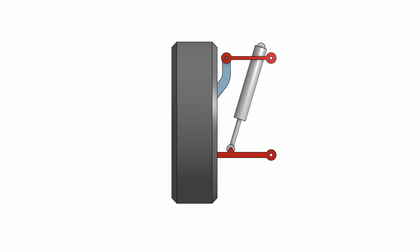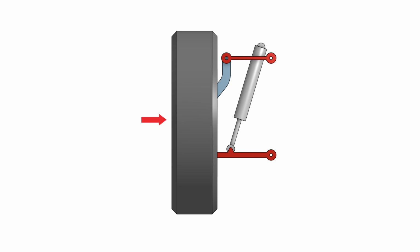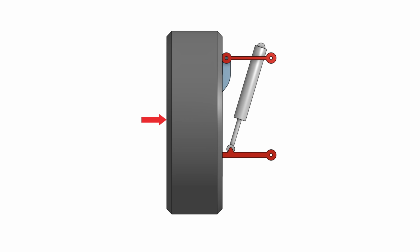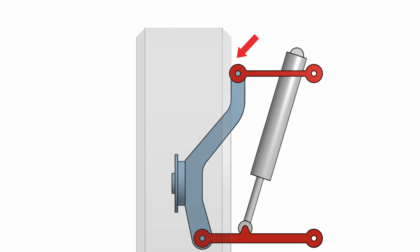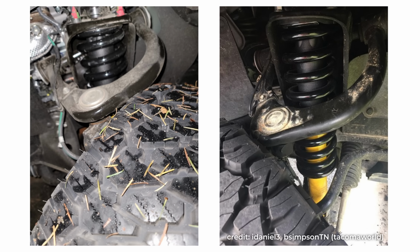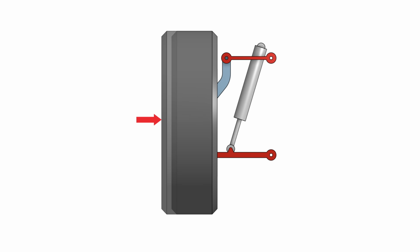When upgrading to a taller tire, many also like to go for a wider one. Just like wheel offset, this will also stick out closer to the body mount. But a wider tire also sticks out closer to the suspension, and sometimes it will rub the upper control arm. In that case, we kind of have no choice but to run a lower wheel offset. And that again will reduce the body mount clearance. We're basically getting pinched from both sides.